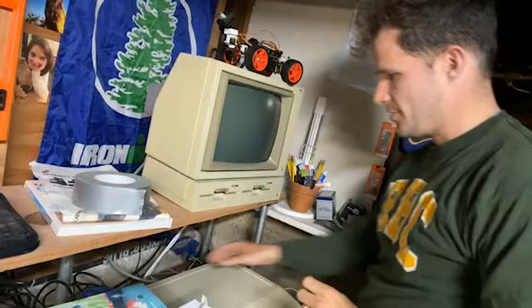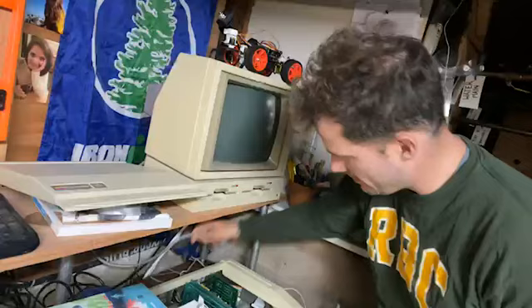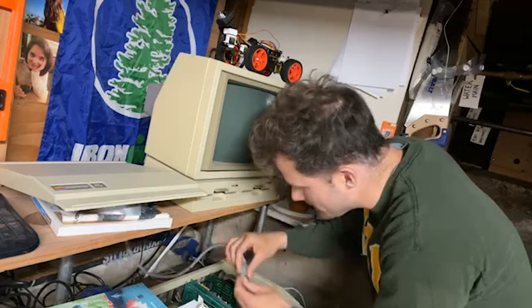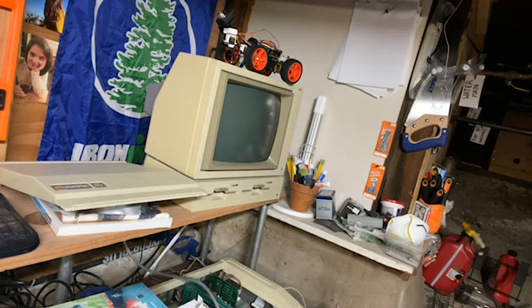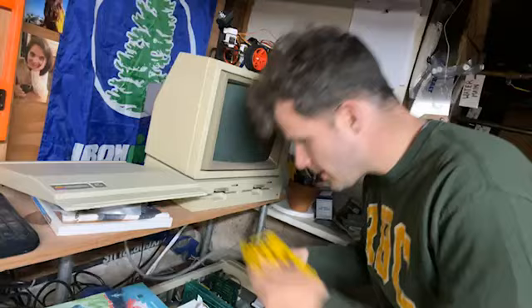Case comes right off — very nice. So it came with a bunch of cards in it, and one of these is the card for the disk drive. This is the plug. I don't think I have to do much other than plug it in. I'm just going to leave it completely off and not put the back on. It has these little screw things — let me find my little screwdriver. A little screwdriver kit, good for when you're fixing glasses and whatnot. I think I need to unscrew these in order to plug it in.